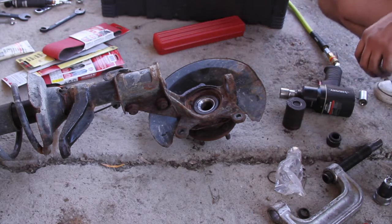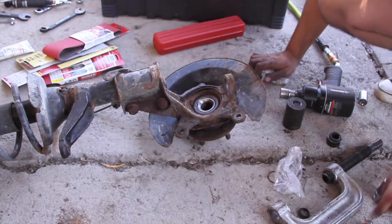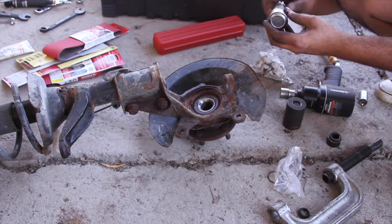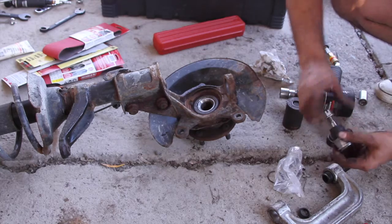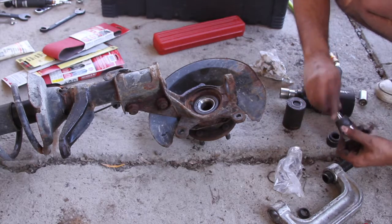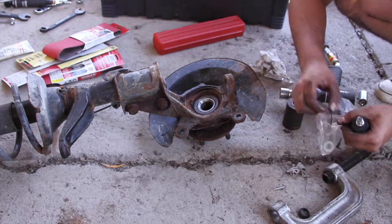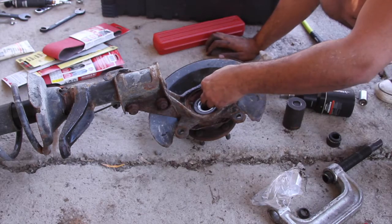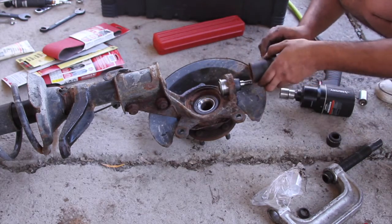And now let me get the new one. The new one is actually easier. Let's go ahead and take the castle nut off. The kit that this customer got, I recommend it, because I hate the ones with a little clip, a little grease thing on it. This side's actually easier, so all you're going to do is start feeding it in,